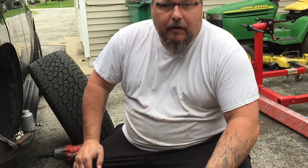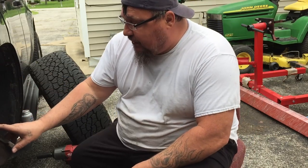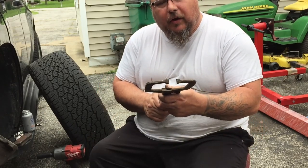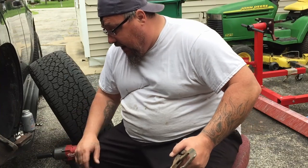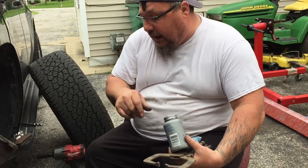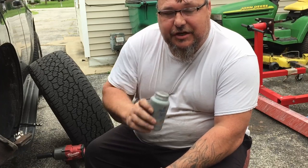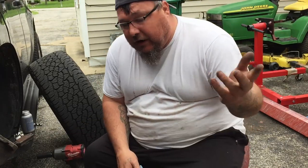I need to get a brake controller in here. When you go to compress these calipers down, use a vice grip C-clamp, stick it in there, and always take your cap off the master cylinder and decompress it slowly so the fluid goes back up to the reservoir. I always clean everything up with a wire brush, but this one's actually real clean so I just wiped it out with a rag. Put a little dab of Never-Seez in the brackets to help the pads slide, and I always put Never-Seez on the wheel studs too.